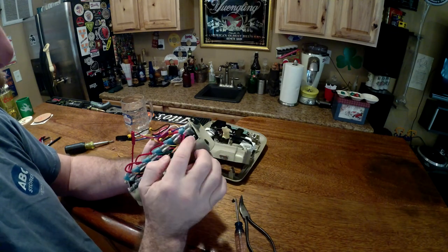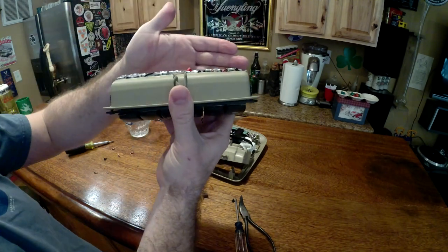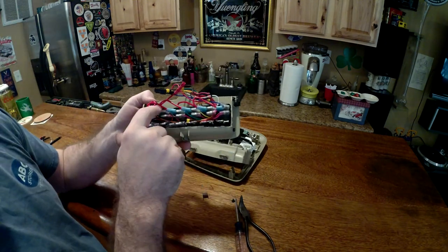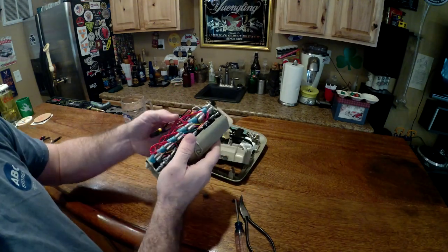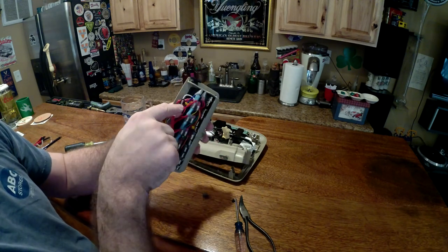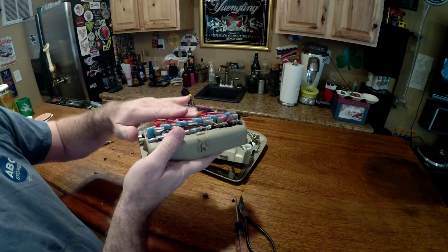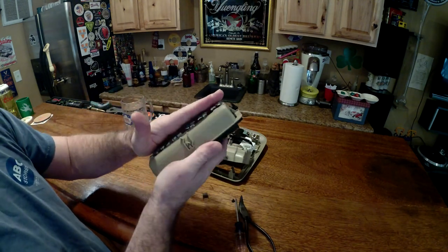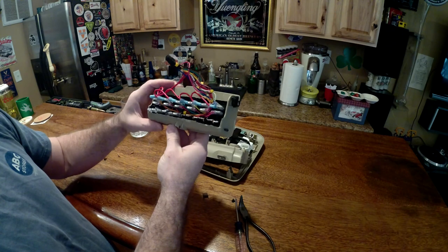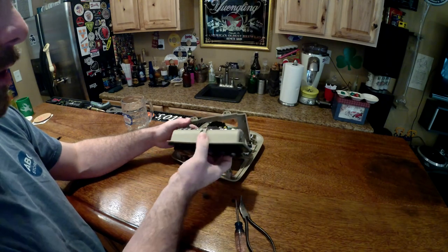You can see from the side profile, I have everything mounted as flush as possible so that it'll fit in there as good as it can. That took some work getting these flag connectors lined up together and making sure all the crimps were holding tight. The last thing I did was took all these internal wires that needed to come out in this harness and routed them out underneath each of these flag connectors so that none of that was protruding. Initially a lot of those wires were sitting on here and it just wasn't enough room. Right now the way that it is, it just fits. Before I was hoping I'd be able to put this in and open up the sunglass holder to access some of these things, plug in the wires and fold it up — that's definitely not happening. This is going to have to go in all in one unit.